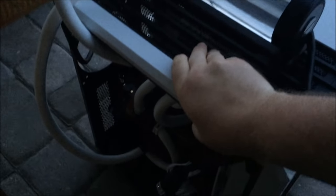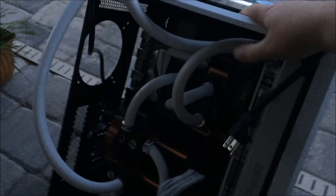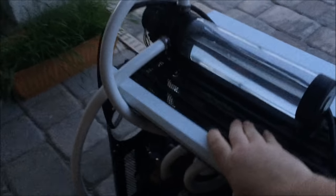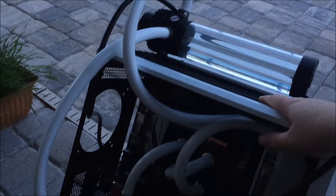Well, unfortunately, as much as I'd like to say that this was a success, some problems happened. First of all, the outlet did not quite reach an angle which allowed it to outlet correctly. Secondly, the loop fought against gravity far too much. I did not want it to fight gravity that much, and obviously nothing came of it. So I tried adjusting the speed on the pump, maybe trying to get some of the air bubbles out. Nada, nothing worked. Then the motherboard started flickering like crazy, and now I can't get it to turn on.